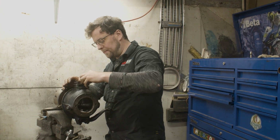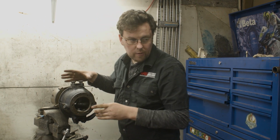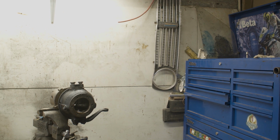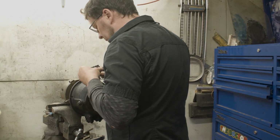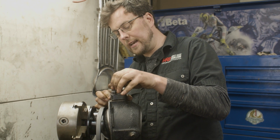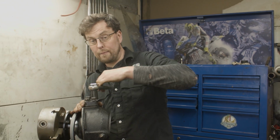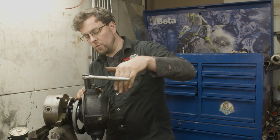So we'll just whip out these bolts, and when they're loose, we can add another shim or two underneath there. We have a reasonably heavy shim here, so we'll try that one in there and see. The good thing is, with a couple of heavy shims in there, we can take out some lighter ones as we get near it. It's very like shimming the ball joint in a Mini actually. Same kind of principle: you're using shims to obtain preload. It's old technology, but very functional and works very well.